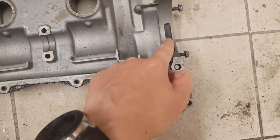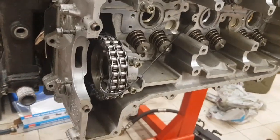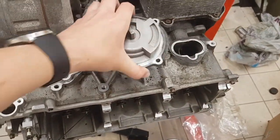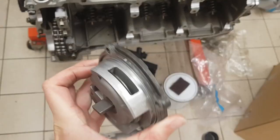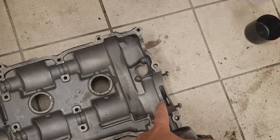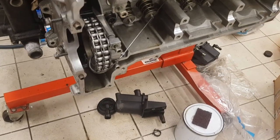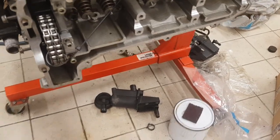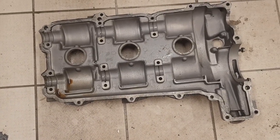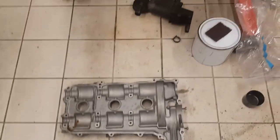There's a hole machined at the back and it comes out on a slot which goes to where the exhaust camshaft sits. The scavenge pump for this has two holes in the side and one outlet — it sucks the air and oil in and sends it back to the block. So there are no pipes required at all; it's all built in within the engine. There's no complex machining of the casting required because the gallery is actually part of the head and the cam cover.